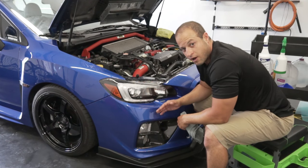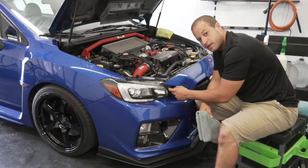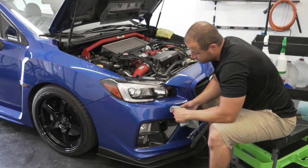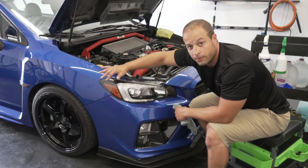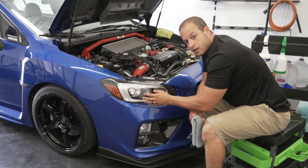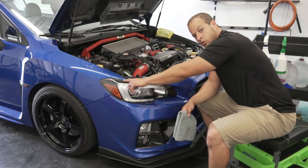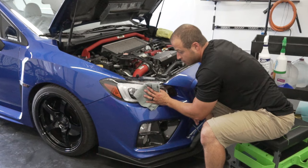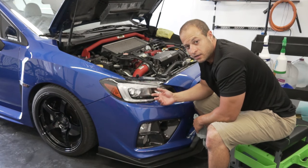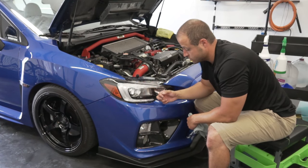When you're doing this, make sure you're not distracted. Get your starting point and then work your way around it. I started right here in the corner, tacked this down, then stopped because I had some fingers right here. I stretched the film across — and when the film comes, it's short, so you're going to have to pull it a little bit, but you have to make sure you have a tacking point. Where I saw my fingers were in this region, I pulled it across, which stretched the material over the corners and that difficult area, and it came out totally fine. Everything looks good. Now you don't have to worry about yellowing or your headlights getting chipped up from rocks. It's a self-healing material — so if it does get scratched, you heat it up with a heat gun, and if it's not super deep, it will go back to the original shape.